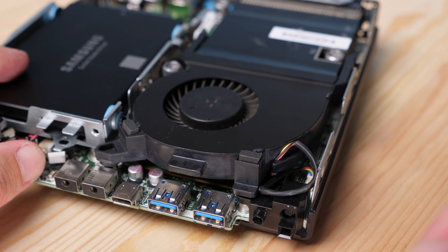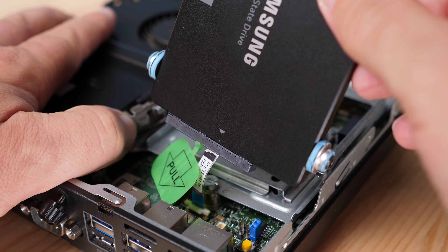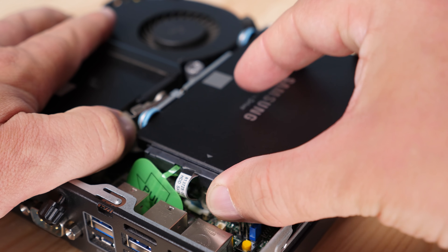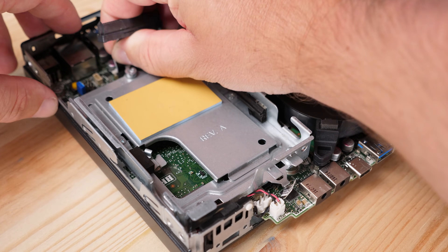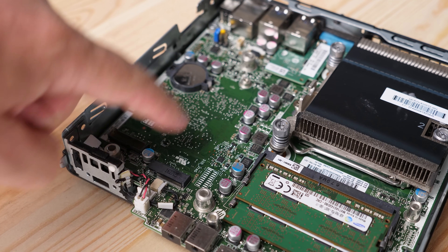As it is, our unit is very quiet, although we did have a unit recently that was pretty loud — we'll talk about that in a different video. Inside the unit, you can flip up the fan and find the two SODIMM slots. A lot of these systems came with hard drives, though some came with two and a half inch SSDs since those were more common when these systems were new. We got a Samsung 850 Evo 250 gig drive. HP has a cool mounting system with vibration dampeners designed for hard drives, which are nice to have since they're hard to source separately.